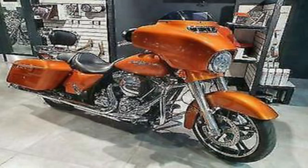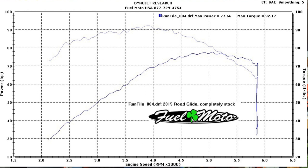One of the most modern used motorcycles you can buy with all the bells and whistles, especially if you get one 2014 or later, is any Harley-Davidson big twin with the Twin Cam 103. The 103, in my opinion, is probably one of the best Twin Cams out there — I really feel like Harley-Davidson got it right. They had the compensator issues worked out. It is a twin cam so it does run hot, but there are ways to fix that with oil coolers. The 103 is where we really saw power and torque levels start to rise — about 75 horsepower right out of the box with the Twin Cam 103HO, which uses a higher lift cam compared to the standard 103.